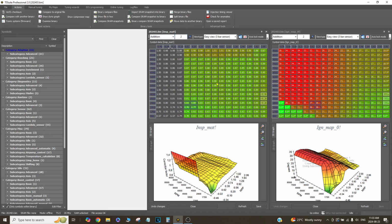And yeah, you'll notice my off boost section is scaled really small because this car is always in boost. I'm always beating the crap out of it. So it doesn't really need that. So if I did run closed loop, then I'd end up with a whole bunch of weird adaptations happening off boost where I don't need it, and then it's gonna screw up the map in boost. So running just fixed fueling works really well.